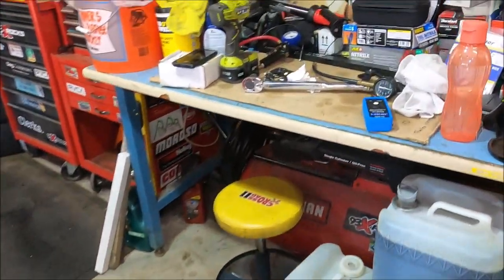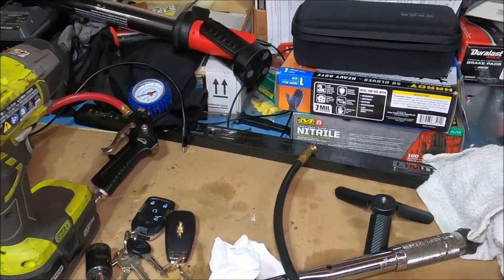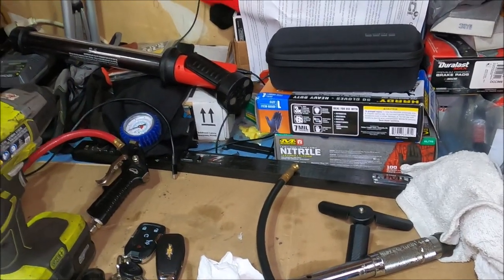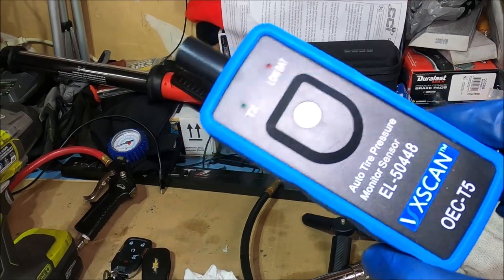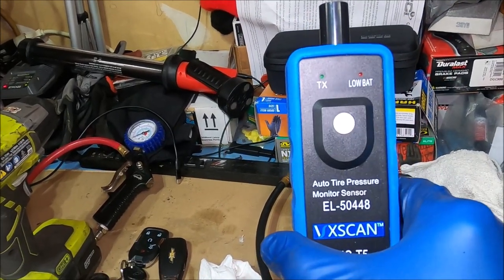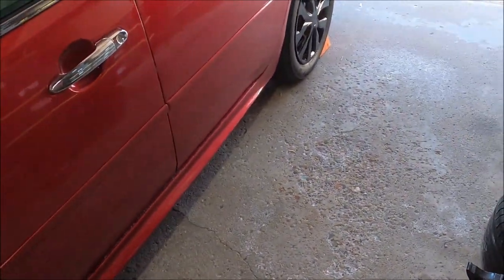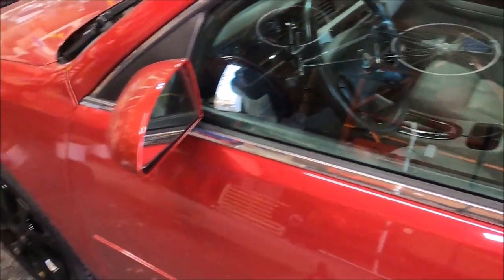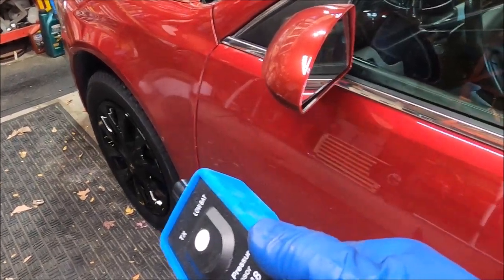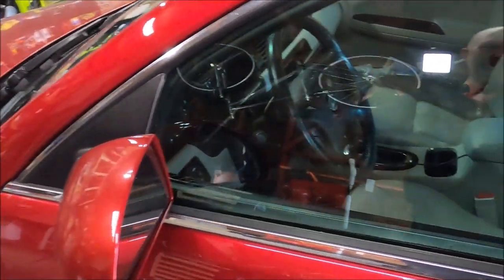Okay, so now I'm going to go around and just check all the pressures with my gauge. I'll probably put them to 35. And then I'm going to go around and set the sensors. I will link this in the description. So I checked all my pressures and we're good. So what we're going to do is set these sensors. We're going to start at the driver's side left, and the turn signal will light up in each position to tell you which one to check.